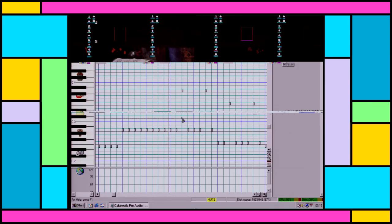The sound card's not as good because I haven't got SPDIF, I've got no FM synthesizer. The video card doesn't work properly. I need to replace it. Occasionally it goes a little bit weird, like it starts corrupting the display. It doesn't seem to be a dry joint, so I have no idea. Luckily the G100s are that cheap, I'll just pick another one up. Maybe get the SGRAM version, see if it really isn't any faster. Because I can't see it causing me a problem if it's slower, to be honest.